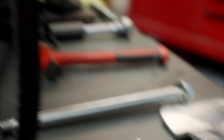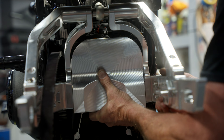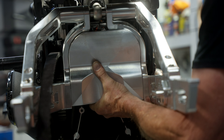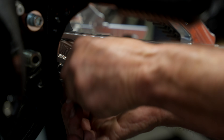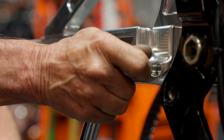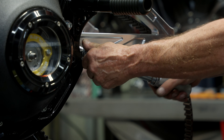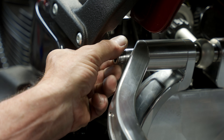Once that is in place, we're going to put these bolts in left and right. This is the structure that goes between the right and left swingarm. At this point our main pivot is not tight so that thing can flex a little bit. Once we torque these down, we'll go ahead and torque down the main swingarm pivot and the shock point pivot. Turn those down with the gun and then go behind and torque them to spec — 5/16 bolt, 24 foot-pounds. All torqued in place — now your swingarm is rigid and solid.